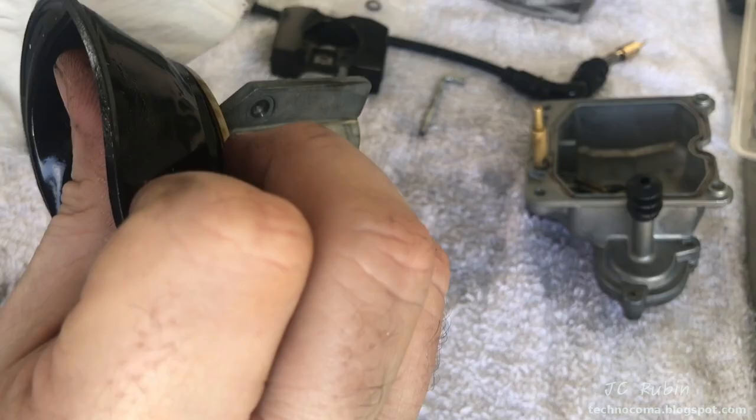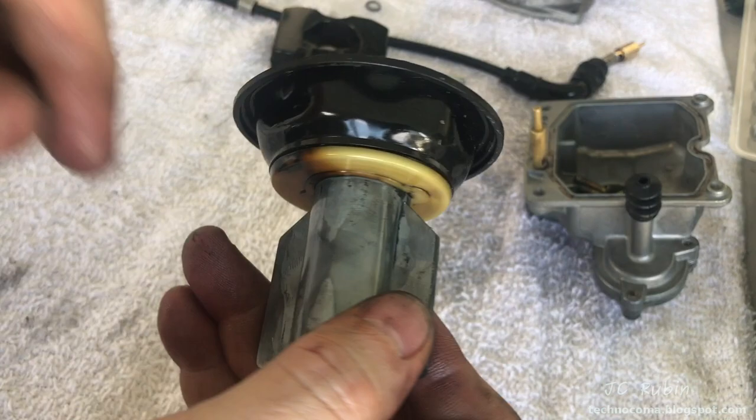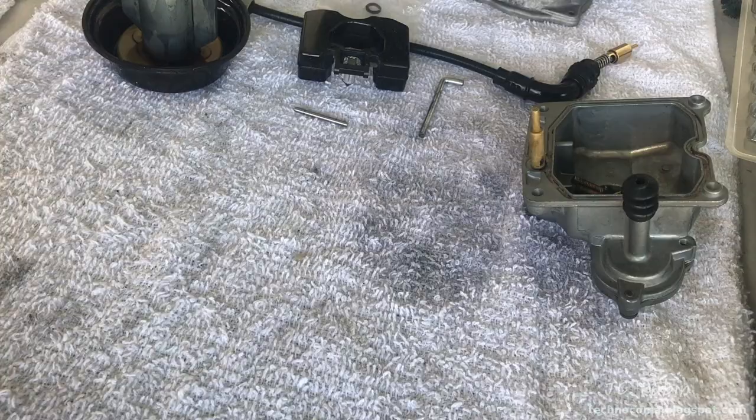With a clean paper towel I remove the oil, which brings up all that dirt and carbon with it. Going through and checking the rubber — there's one area with a burn in the plastic, a darker area, but the diaphragm wasn't damaged so we can continue with this part. These pieces are all being replaced but I'll clean them anyway for the video.